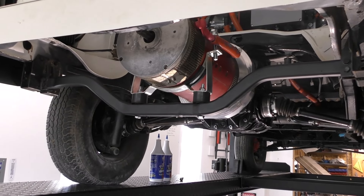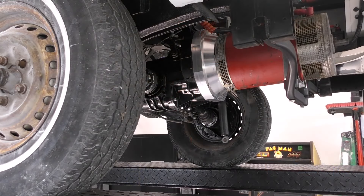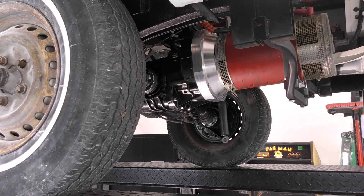This is normally where I'd say thanks for watching, but I want to do a few follow-ups from the last video. A commenter noted I didn't really explain the motor installation — and I have to agree. Installing the electric motor with a clutch is almost identical to installing the original engine: you put the car on the ground, jack the motor up until it meets the level of the transmission, push the motor onto the drive shaft, and put the four bolts onto the transmission adapter. The difference is that the electric motor has aluminum hub coupler and flywheel parts, so you need to take a little more care — you can't just wiggle and jam it into place.